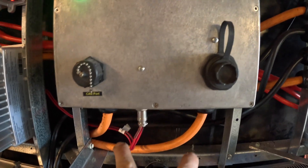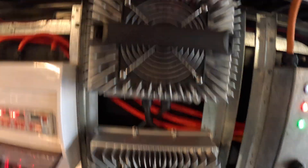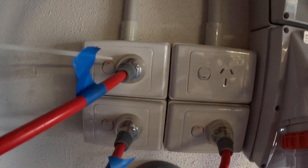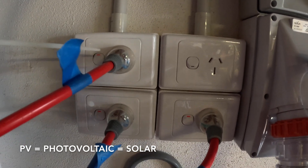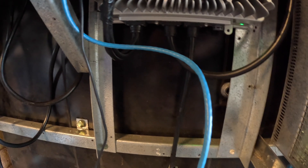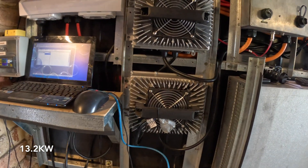This box just makes it appear like a normal battery, so you turn it on and you've got 400 volts coming out here. That goes into the high voltage junction box, and that in turn goes to chargers. Currently I've got three — these are three 3.3 kilowatt battery chargers running on the grid. I've got four 15-amp sockets installed by the electrician and they charge one, two, three.